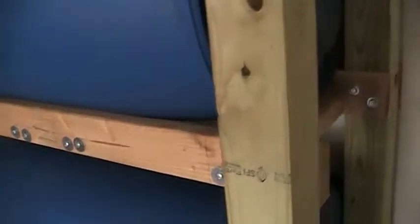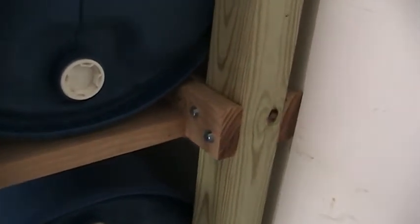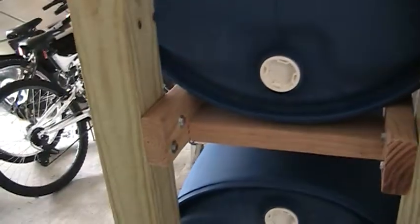It's all put together maybe a little bit more than it needs to be, using lag bolts rather than screws, but I figure the weight of the water warranted the overkill on the design. This is also anchored to the wall, as you can see, with a 2x4. That 2x4 in the back is anchored to the studs in the wall, and it was secured after the 4x4 posts were secured from the back side — so this isn't going to go anywhere.